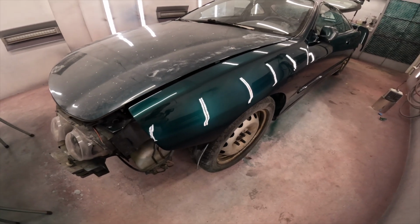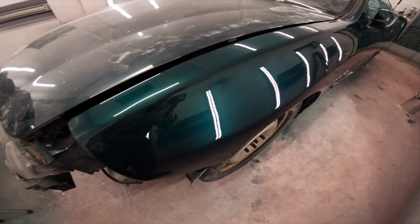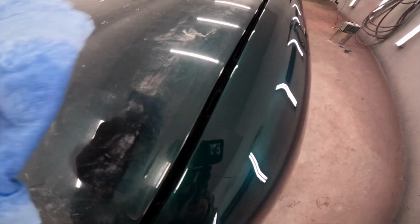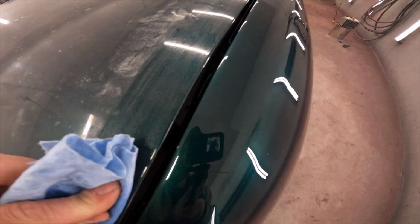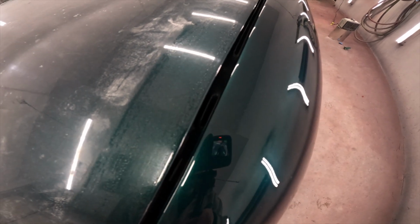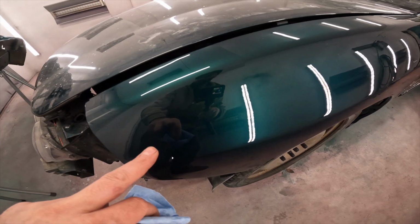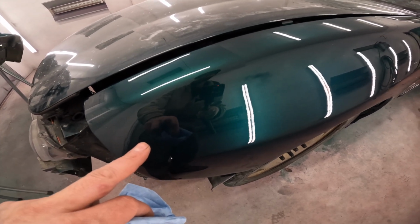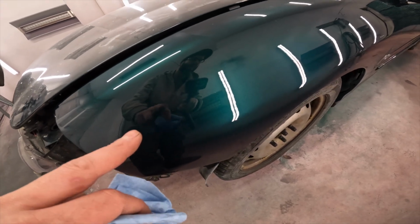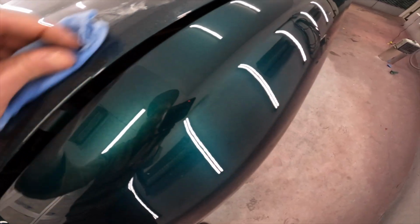The next day, we are all painted, we are all clear. Everything turned out pretty good considering. I know it doesn't look like it is a good color match, but we have like months of dust on the rest of the car. So there we are. That's actually really good. I'm happy with it. When I got this paint for the Integra, they gave me a choice of 3 different tones: dark, light, medium. I went with the light to compensate for any sun fade on the original paint.